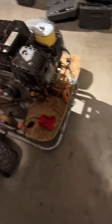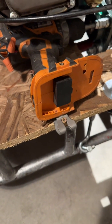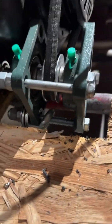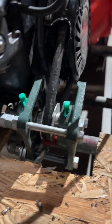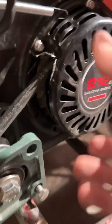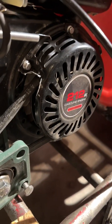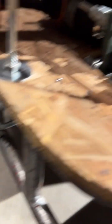I took apart the drill and rewired it so it goes directly to the motor, so you can't use the push button on the drill anymore. I bought some flange bearings on these flanges here, then bought a V-belt and tore open the side of the casing where the pull string is. I took the rope off and put the V-belt in the groove where the rope usually goes, then tightened that down with a tensioner.